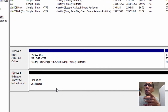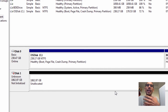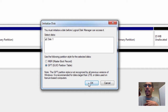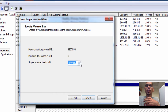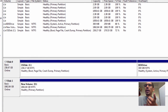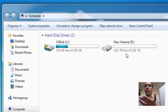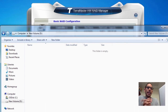Let's go inside Computer Management. We need to do a few extra steps: right-click and initialize the disk, choose GPT, press OK. Then right-click and do a new simple volume, use all the space, assign it as the D drive, do a quick format, and finish. The reformat is done. Closing this up, autoplay appears because it detected the D drive. Going to Start → Computer, there's our new RAID drive. Super excited about this — I'll probably purchase more hard drives to set up a RAID 5.